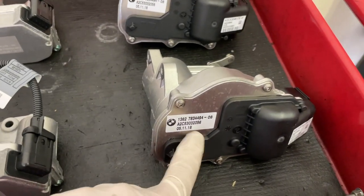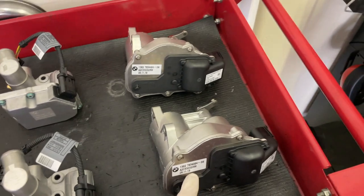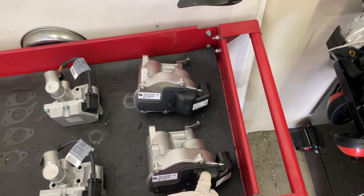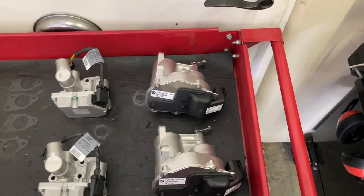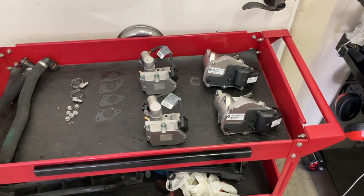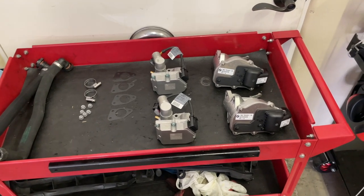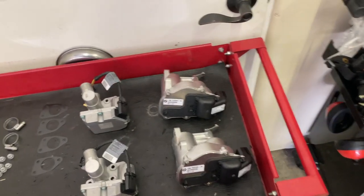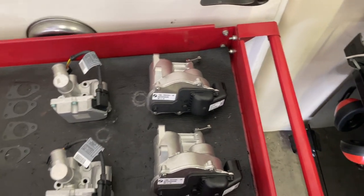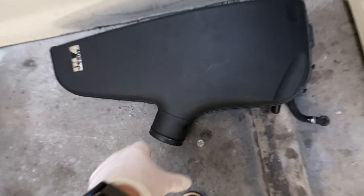The new parts look fresh — build date November 5th, 2018, so just two years old. There are some aftermarket alternatives. The actuators' electronics and linkage are fairly stable; it's the plastic internal gears that are the weak point. BMW used plastic gears to save money, and over time they get hot, brittle, and strip or lose a tooth — that's the failure mode. You can rebuild them or just replace them and expect roughly another 65,000 miles before they fail again.